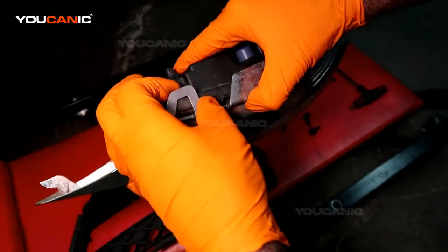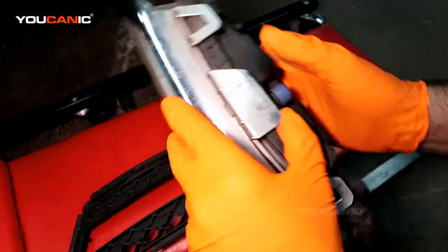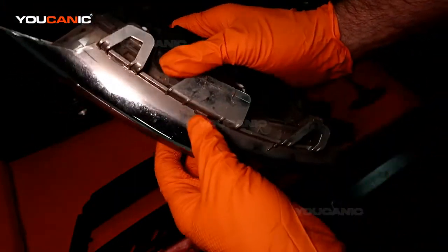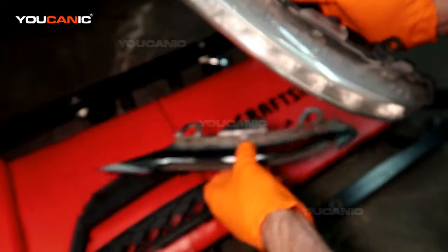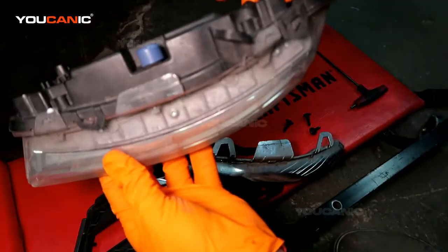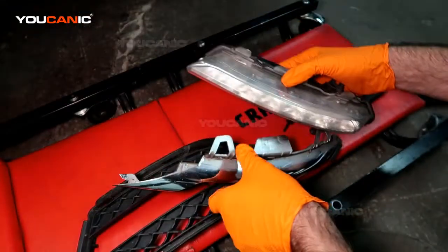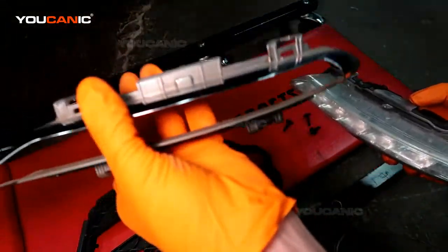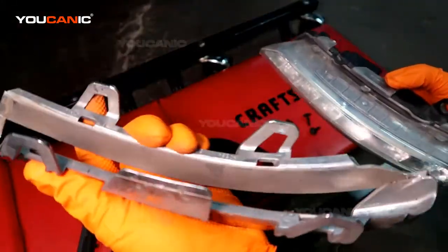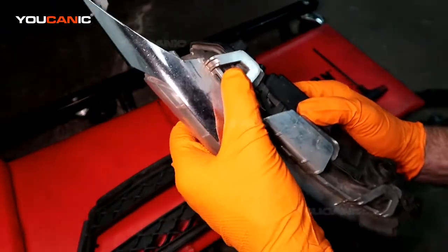This little chrome piece will just pop off — it's just clips, so you work your way around. It's got plastic tabs in here; you just work your way around and pull it off. As I said, this is all LED — there's no individual bulb you can replace; you replace the whole unit. When you get a new one, you just go ahead and put it all back together in reverse. If you just needed one piece because it was broken, they're sold individually.